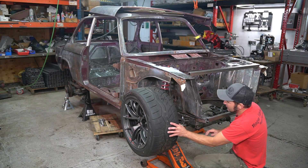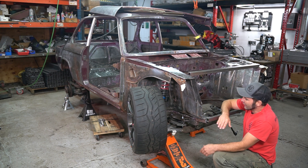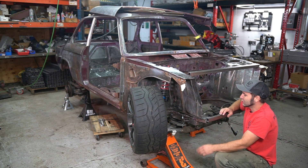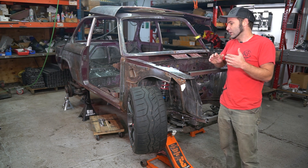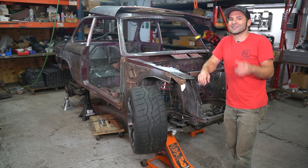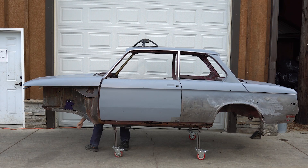The issue when we set this thing up is that our control arms are actually at a bit of an angle, so we're going to want to drop those back down in terms of angle by moving the frame mount up. We've got to pull our entire front cross member up — that's going to include taking the OEM boxes off the bottom of the frame and building similar boxes on the top side of the frame. That's going to allow us to raise the subframe, correct the control arm geometry, and allow this thing to handle quite a bit better — a lot more like a factory E46. Next episode we're going to get into those details. You're not going to want to miss it. Thank you guys very much and we'll see you next time.